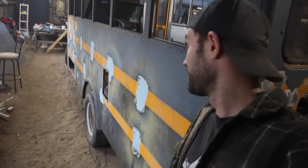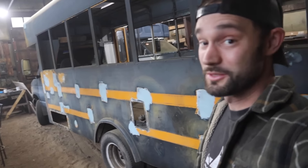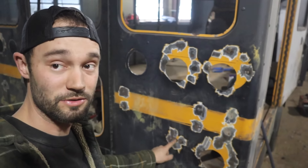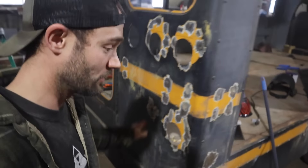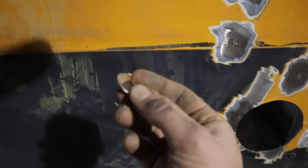This side is completely Bondoed. It may just look like light blue on dark blue, but just having the Bondo on there and not the weld spots makes it look so much better. Next thing on the list is the back section. These holes here used to be for the reverse lights, so we're gonna replace those with big LEDs. I used a quarter — it fits perfectly — so I traced it out. I gotta make two of those, tack them in, sand out the back, and then Bondo that up.